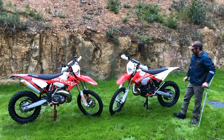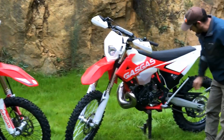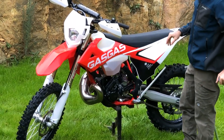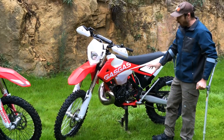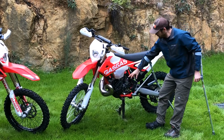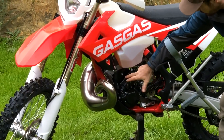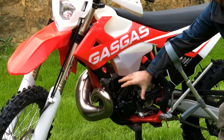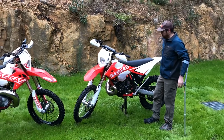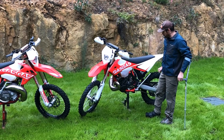The frame looks similar to an Austrian frame actually, but clearly it's made in Spain. The motor is quite different — it's not a 100% replacement from the old GasGas motor. You can still see the starter motor sits on the outside at an angle like the older ones. The barrel is different, the power ports, the pipe — a lot of the important bits have been changed. Really it's the bottom end and the gearbox that's still similar to the old motor.